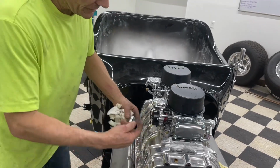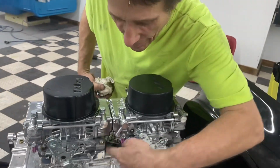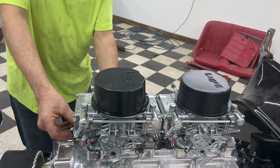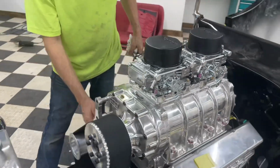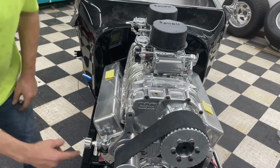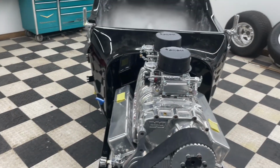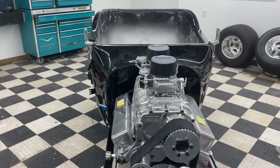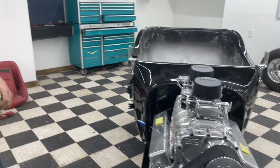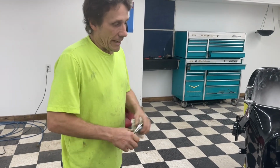And then this line's going to run through the inside there. I've already moved our banjos. This one's going to go up to here. This one will come and go up to there with the 2 fuel filters. And then I can hardline right from our pressure right to the block. I think that'll look pretty cool. And then we're going to hardline from here to here. So I think that'll give it a pretty decent look. We've got almost everything to do that, except for the T, probably. Oh, and I need another fuel filter.